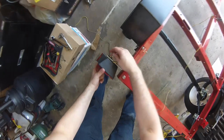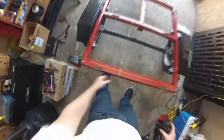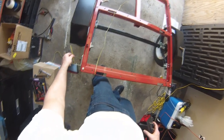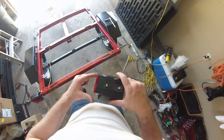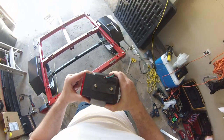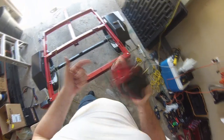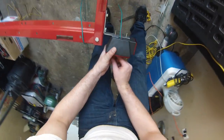Okay, mess up number two is these. Remember me looking at this part, on the bottom of this little part earlier where it's clear, kind of wondering, does that matter? It does. The reason why is the wiring. Whenever I go to do the wiring, if I install these wrong, whenever I turn my right blinker on, my left blinker will work. Or vice versa. And as I mentioned, I want the brake lights to be proper too. And if you look at the back of the device here, it tells you stop, turn. So, top. Yeah, screwed that up. Had I paid attention to that, I'd have gotten it right the first time, not be reworking right now. Save myself time.